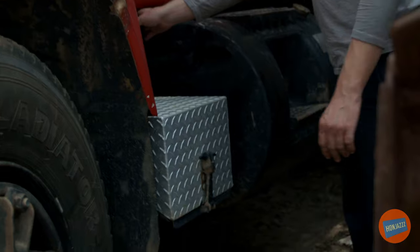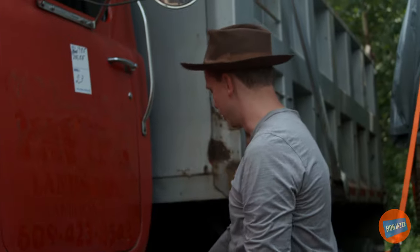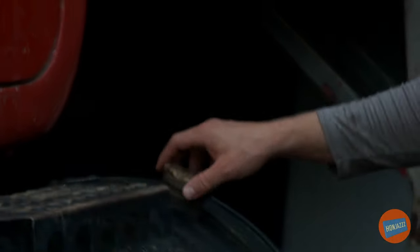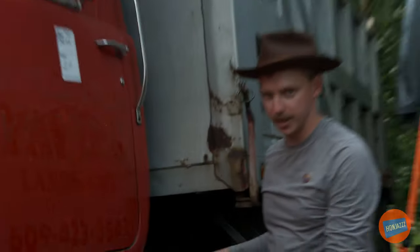This is the battery box right here. The cab mounts are accessible, it's easy to get to the hood latch on either side of the hood. The hood comes straight down — it doesn't have the access window like on the older U-model; the hood tilts forward like a conventional truck. Brass fuel cap, which I really like — it has a nice classic feel to it. It's not cheap, not crappy — it's actually a piece of brass and it'll last a lifetime.